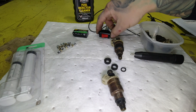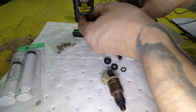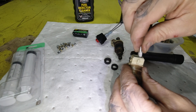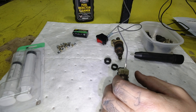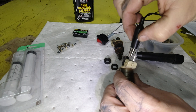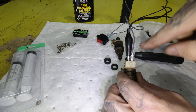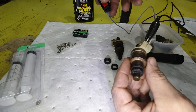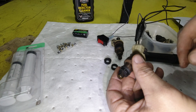I've wired a simple switch into one of the wires here, and I used an old piece of speaker wire with one of the small terminals so that I can clip that onto one side. And then I was feeling kind of lazy, so I just got an alligator clip for the other one. But you can do another speaker wire terminal, or whatever you want really. And then when you hit the switch, the injector will cycle.